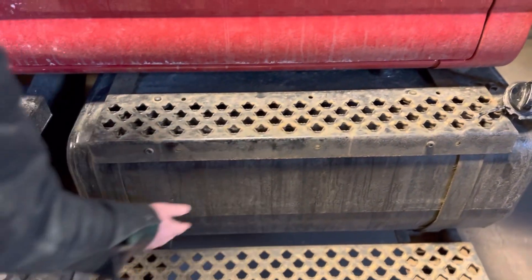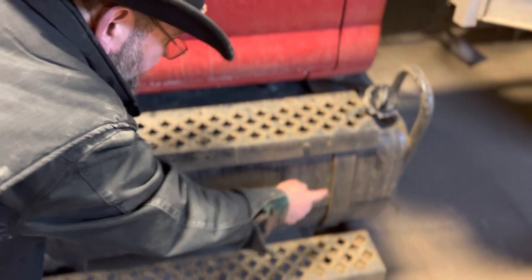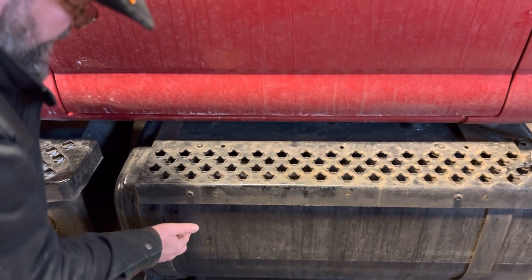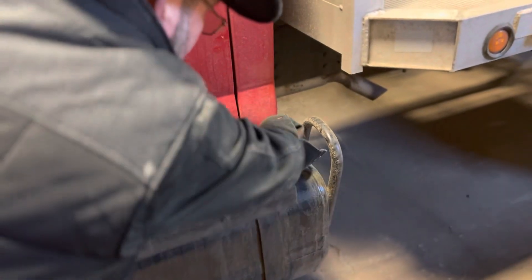Fuel tank and cap and leaks. My fuel tank is right here, and my fuel cap is right here. The fuel tank is securely mounted with this strap right here and this strap right here — they're not loose or missing, there's no missing nuts or bolts. In between them there's a little piece of rubber that's not worn through or missing. I don't have metal touching metal. There are no cracked or missing welds here or around here.